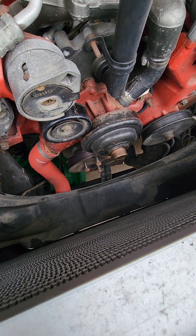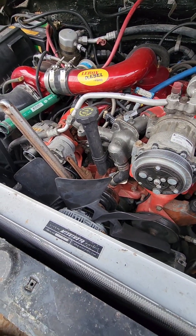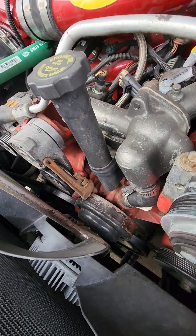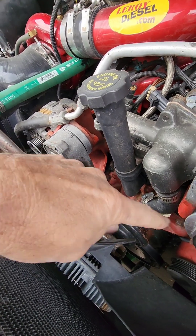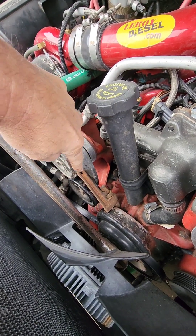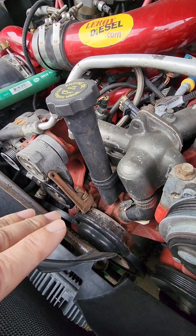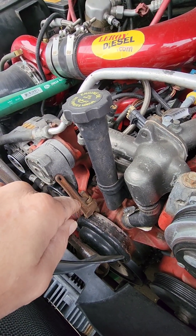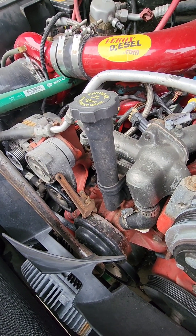By the way, that pulley is available — it's a billet pulley, go to leroydiesel.com. So I was actually lucky this one was not very tight. Let me show you what an average guy in the driveway could use: get the belt off, then on your pulley get a tiny pipe wrench — you could use one a little bigger — and catch it right there behind the pulley. If your fan clutch is super tight, be careful you don't deform or bend your pulley.